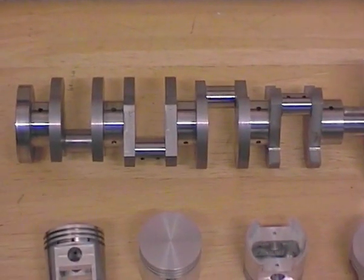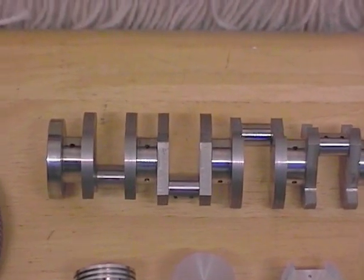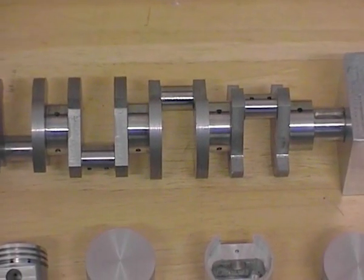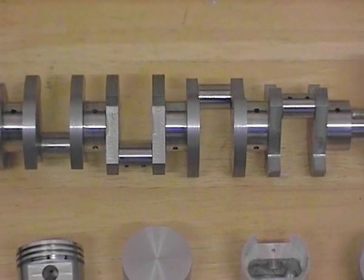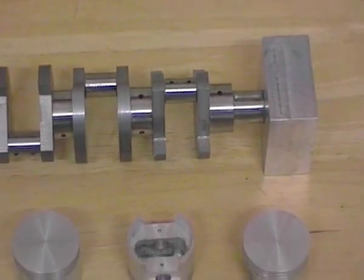I'm just zooming into the crankshaft, trying not to shake too much. You can see the oil holes that I've drilled into it. Like I said on the previous video which is now lost, I actually ground the crankshaft mains and big ends to round — they've still got to be ground to final sizes when I've finished the crankshaft grinder, which is just going to have to wait.